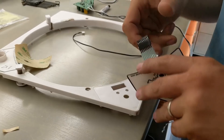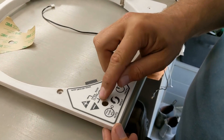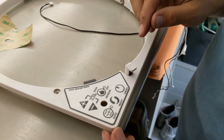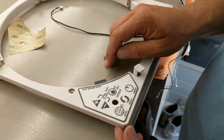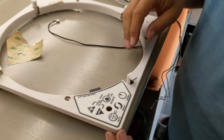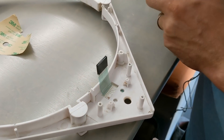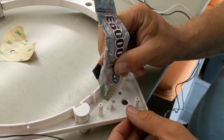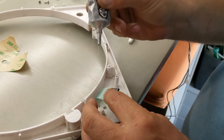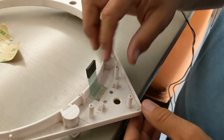First I'm going to install this — just peel the backing off. The other thing that caused a problem was the infrared sensor sitting in a little clear plastic dome that filled up with water. This replacement keypad doesn't have that clear dome included, so I'm going to leave it off. But if you want to preventatively keep that from happening, I'd suggest drilling a small hole in that clear plastic dome. Now flipping it over, I'm going to put some E6000 in there and goop it in nice and thick. As long as the keypad membrane adhesive back is pressed on there it won't leak out the bottom.